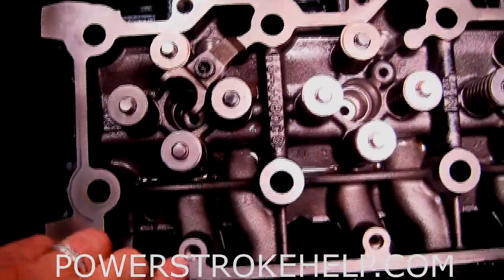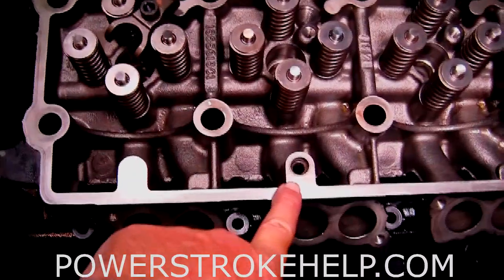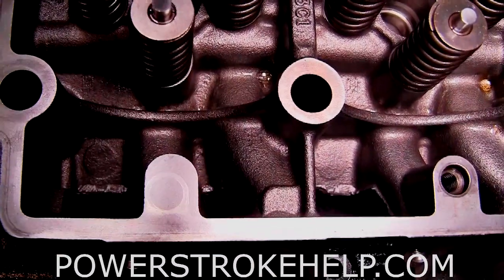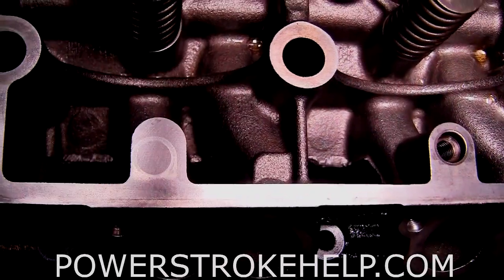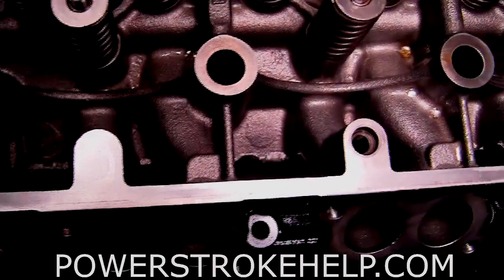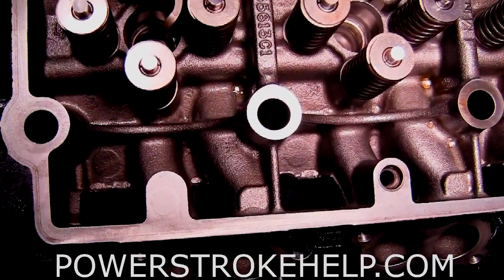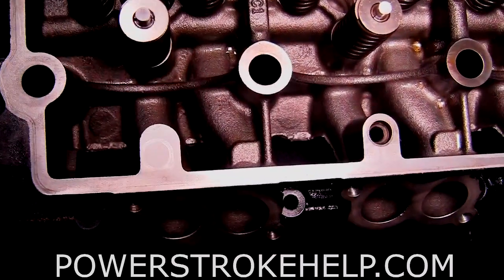So if you have a dowel pin that lines up on this spot on your rocker carrier, it makes it difficult to use this. If you look real close, you can see that someone did use one of the early rocker carriers on this head before we rebuilt it. You can see the wear pattern in there, and it's obvious that the rockers weren't lined up correctly. So we really want to work hard to make sure that we get you the correct head that is either commonized or pre-commonized. Sometimes folks in these shops have to do what they have to do to get the work out, but it would have been a lot better if they had the correct cylinder head.